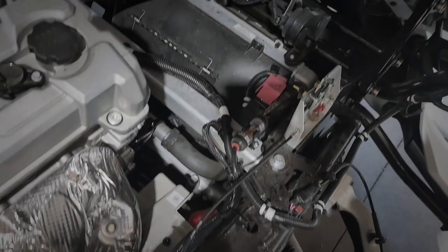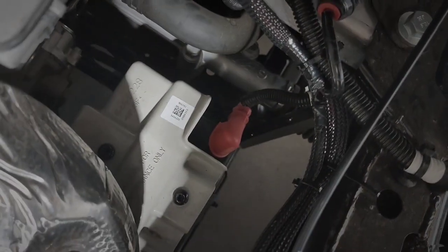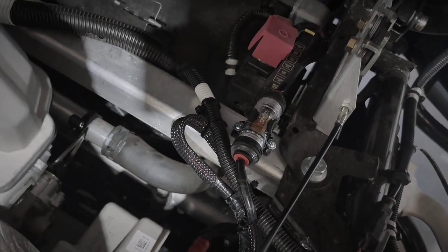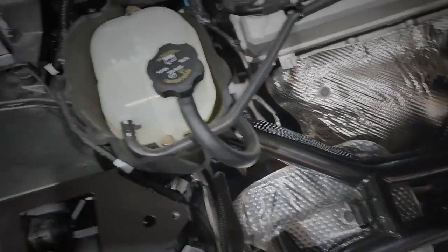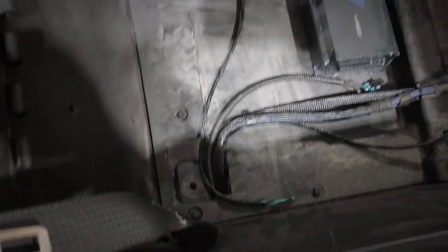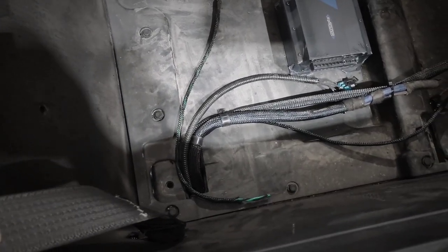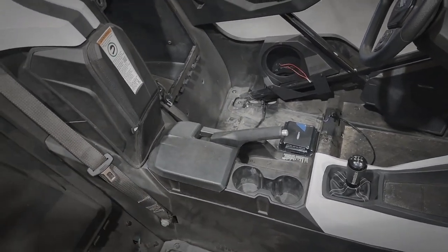As far as wiring up here, I grabbed right at that spot that jumps right down to the battery — I've got the fuse mounted there. I'll change out those stainless screws, they seem a little too large. I've got the ground off the battery, and then my lines run up the frame, away from those heat shields, up to the radio, then drop underneath. I had to jack the machine up to get the wiring to come up through that hole. I knotted it down and turned at a 90 quickly, so there's no chance of any slack getting near the driveshaft — because that would not be good.